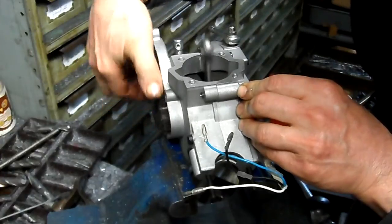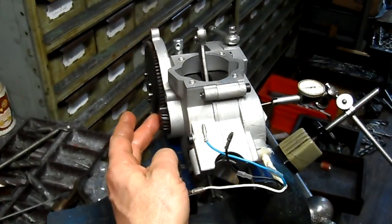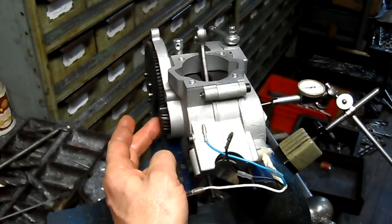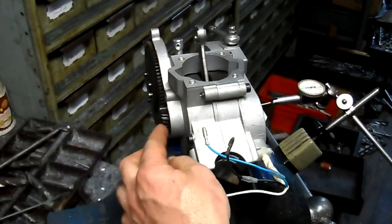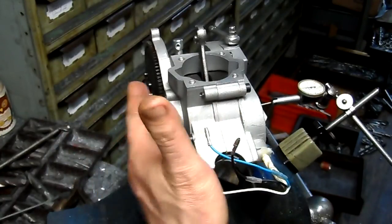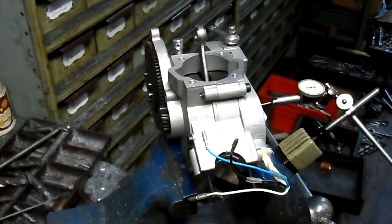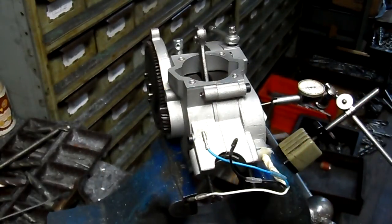That gear moves around too, and it's also sticking out a little bit further than I like — it doesn't have full engagement. So when the crankshaft is out, that's going to get straightened, and I'm also going to dress up the taper and refit this gear so it goes in a little bit more. That's going to be the first step of rebuilding the engine. There'll be more to come.